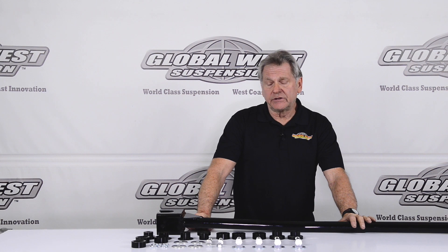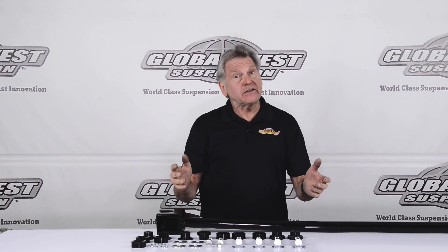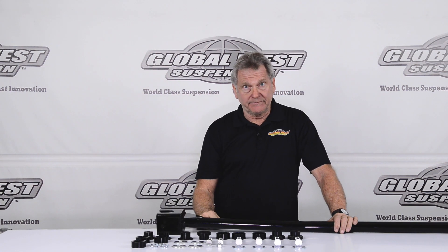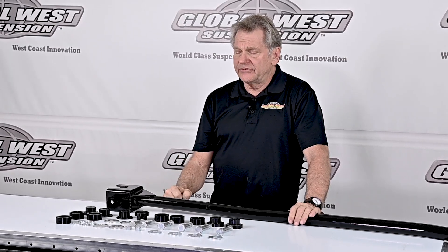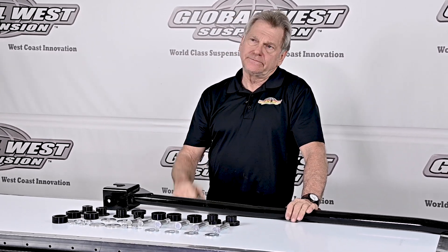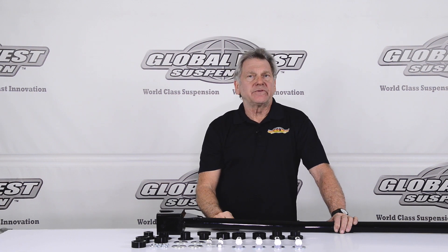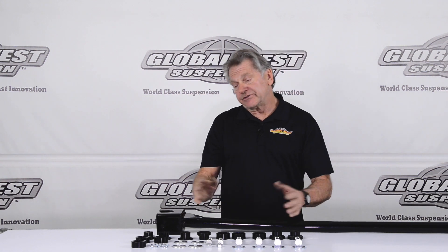There are some things you do need to look for, so that's why I say when you're building a car from scratch, from the get-go, that's the time to put these on. If it's already built you have to check all these different locations. Also, the radiator gets closer to the hood — everything changes. A trick I use is play-doh: put play-doh on top of the air cleaner, slowly close the hood down, and you can see how much of a gap you've got. Also take into consideration that the engine rocks a little bit as well.